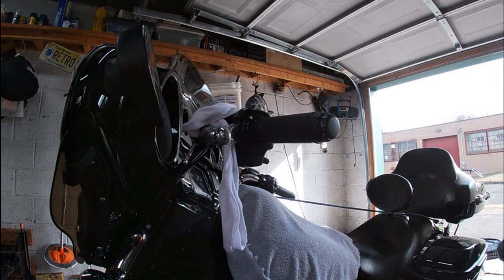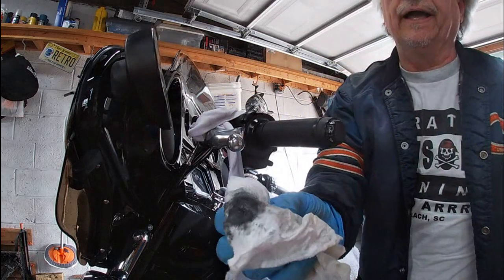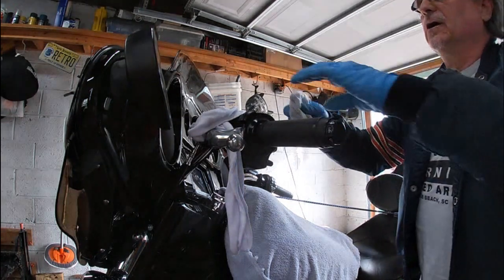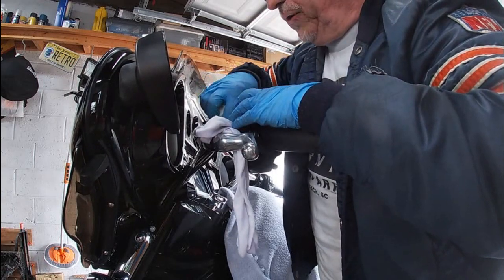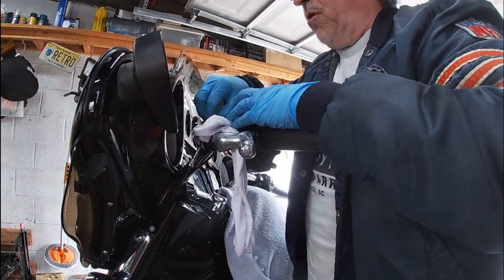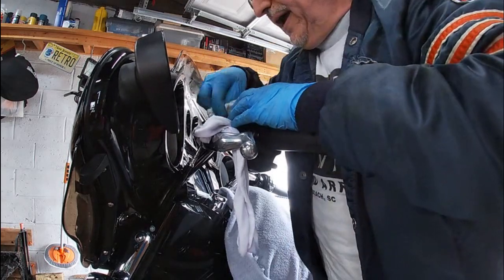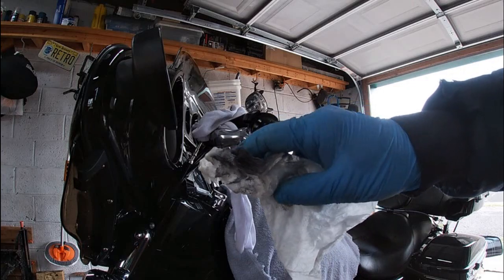That is not good at all. Now we're going to need to brake-clean this sucker. This is why you have to do this every couple of years — you have to keep up with maintenance on stuff like this because the moisture gets in and then next thing you know you're stuck on the side of the road because your hydraulic slave cylinder quit. It's balled up with moisture and corrosion and then it stops working. Now you've got to get towed to a dealer and have them replace it, especially if you're on the road.